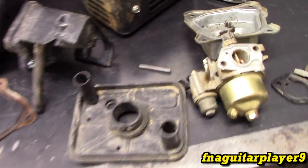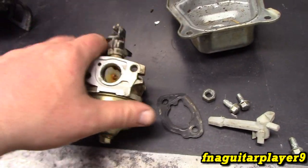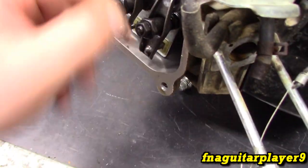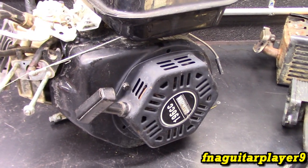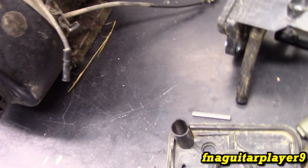Just kind of go from there and see what happens, get everything unboxed and look at everything. Looks like just about everything's here - valve cover, muffler, air filter, choke thing for the carburetor. It's a bit taken apart, there's a gasket for the valve cover. It seems excessively loose. He said it was popping out of the exhaust, so I figured it's either valve related, probably carburetor too, and possibly the flywheel key could be sheared. The gas tank's in good shape, still looks new inside, which is surprising because it's kept outside - might have been an issue with water in the fuel.